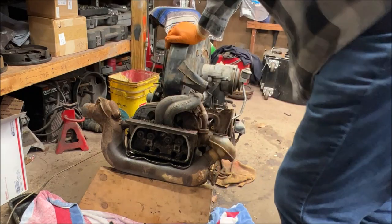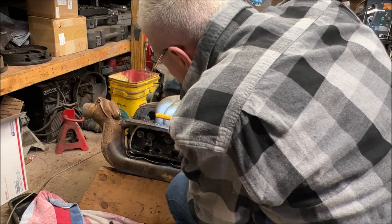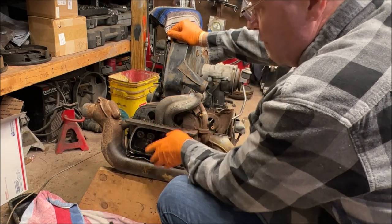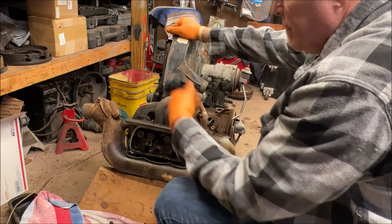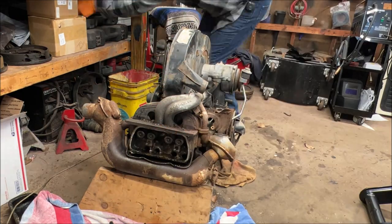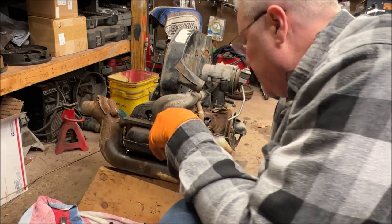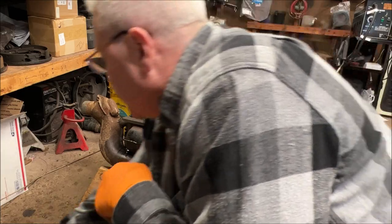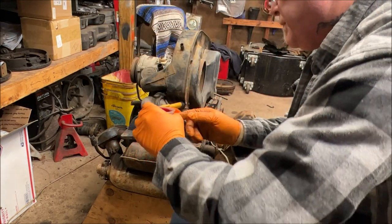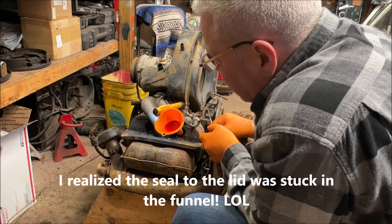It's been 24 hours. That side is still full — I thought it would seep a bit. The right chamber's empty. So I'm going to spin some spark plugs back in, put the valve cover on, then tilt the motor the other way so I can cover the whole piston with the solution. I spun the plugs back in and we're going to go to the other side and put the solution in the other cylinders. Mixed up 50-50 ATF and brake fluid. I don't think that's all going to go down in there — I'll give it a few seconds, and if not I'll draw it out.